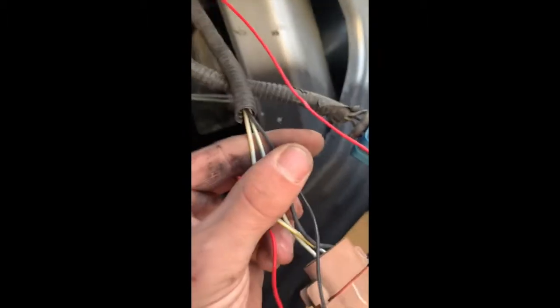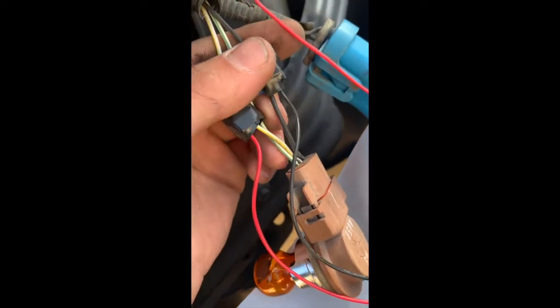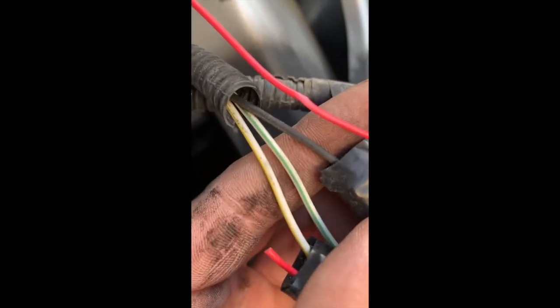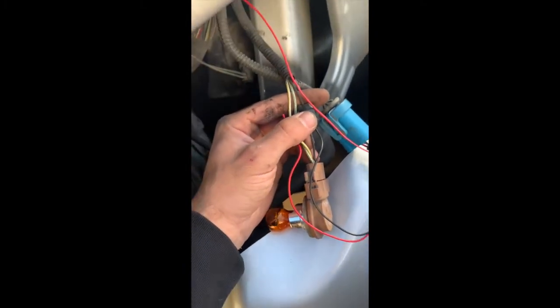Alright, so I have these lights already hooked up as I said, so that's what that red and black wire. I actually added an extension piece. I got it in, I ran it right under here. I can't see it, but it runs right through and then up through here. So first, the black, obviously this is your ground here. If you are looking to do something as a running light, it will be the white and yellow. That's your running light. Since this is a dual filament bulb, that means your white and green right there in the middle, that's your turn signal. So say you want to wire this to your turn signal, you would tap into this middle one. I'm not, since I want running lights, so I'm going into this white and yellow, but just so you know.